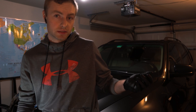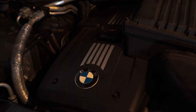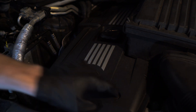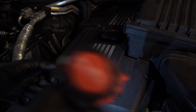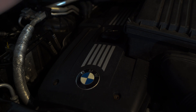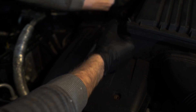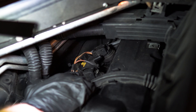Let's pop the hood and see what is going on with it. First we want to remove the engine cover — two T30 bolts at the front and one at the back. Usually the back one is missing because nobody cares about it. We're not going to be able to just pull it out because there are clips going behind the intake or air filter, so you want to lift it up and pull it out.